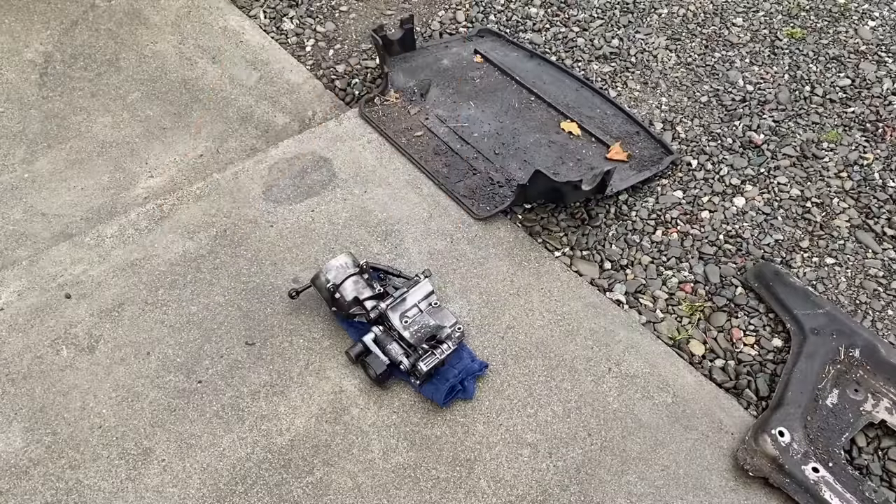Next step: get this mating surface cleaned up. Clean mating surface, as always. I'd only recommend using one of these Scotch-Brite heads if you've used them before. With a soft Scotch-Brite head like this, you're not going to do too much damage — you just can't stay in one spot and really wear down the housing. Put some brake cleaner on a rag and let's see what our finish looks like. Clean up the sealing surface, make sure there's no old O-ring in there — just give it a quick wipe out. Those are nice and clean. Good to go.